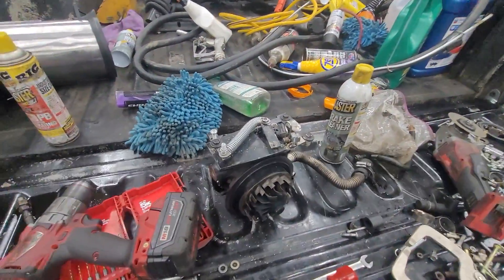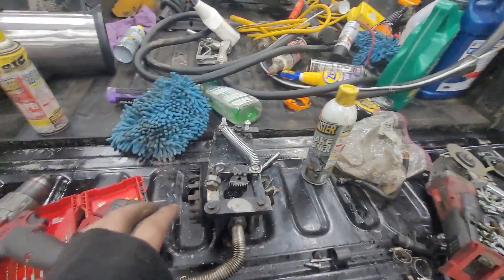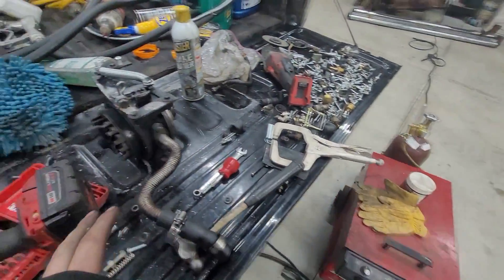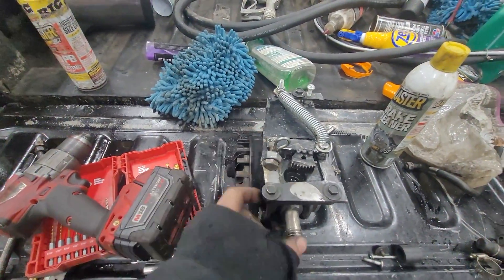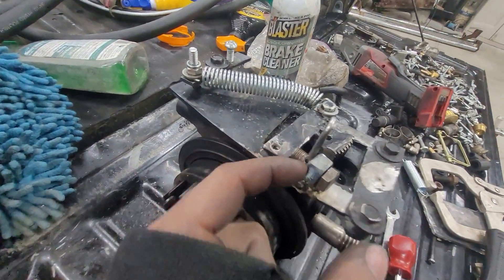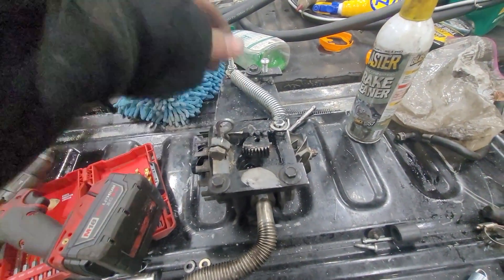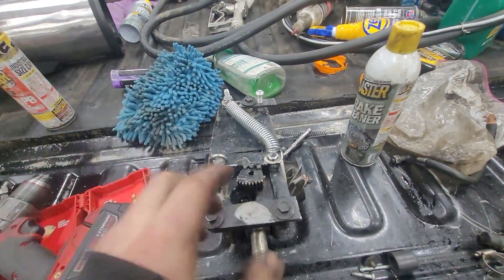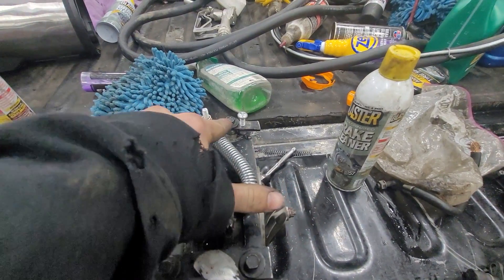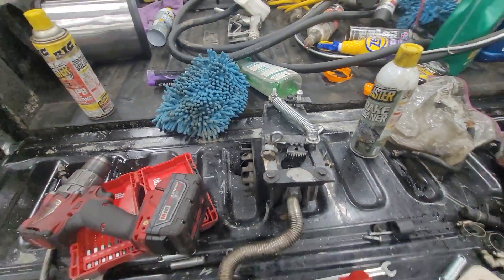Before anybody complains, this is version 2. So basically what we have here - I had to grind down some spots, and this welder is absolutely terrible. It flings slag everywhere, so I had to put a rag down and then the brake link caught on fire. What I did was take a big nut and booger-welded it on here, then drilled my hole right through. So if I want to use the exhaust brake to warm the truck up, I can just pull this pin and it will go right to exhaust brake. You can see how much spring tension is on this thing. I put a set screw in here so that once I lock this down, it's basically stuck in that position - this cannot move. This is going to be version 2.